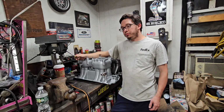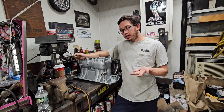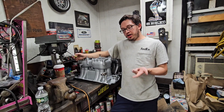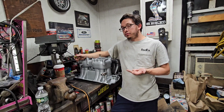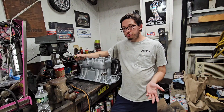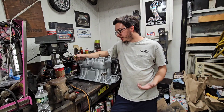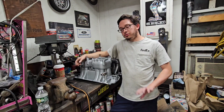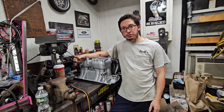And that was another thing. I wanted to put a new timing chain and gear in the car. I wanted to change the front timing cover on the car and a cam button. Cam button's $20 or 15 around there. The Cloyes timing chain is like 110, and then the front cover is about $80. So you're looking at about $210 for a timing chain and gear setup, or spend another $140 and get a belt drive. That's hopefully going to be a little more stable, rob a little less power, and have the accessibility where I don't pull half the engine apart to play with cam timing.